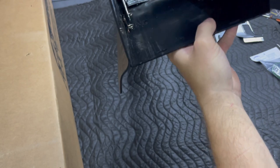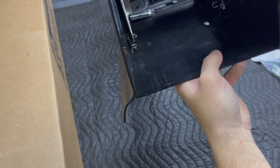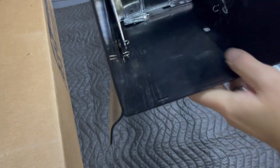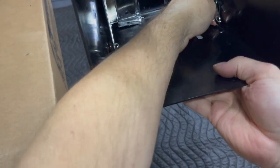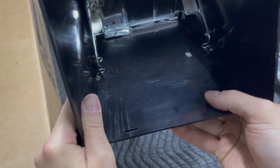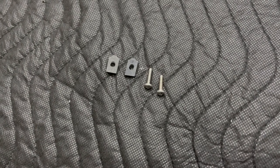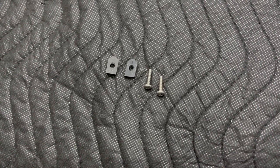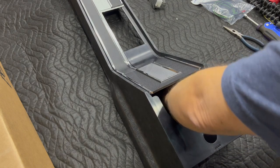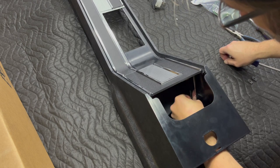The next step is to get the springs into position. Basically what you're trying to do is pull them back forward and hook them into the holes. There are two sets of holes — the ones more on the inboard side are actually for the screws. You're going for the outboard holes for the springs. It's a little tricky in there but quite easy to do; I was able to do it by hand or with a simple pair of pliers. You know it's right when the holes in the springs line up with the holes in the console. The kit doesn't actually come with the screws that hold the springs into the console. Luckily I had some U-clips and screws that did work. It's possible to just screw right into the plastic — it looks like there are some bosses there — but using the U-clips was just a little bit safer.